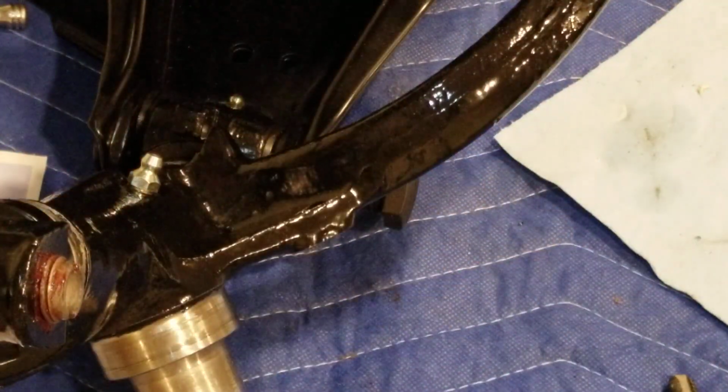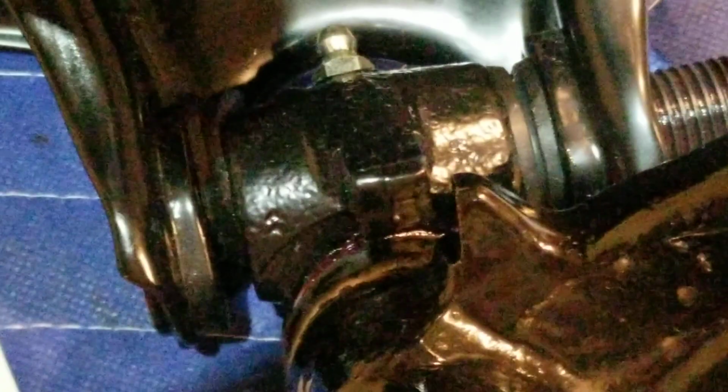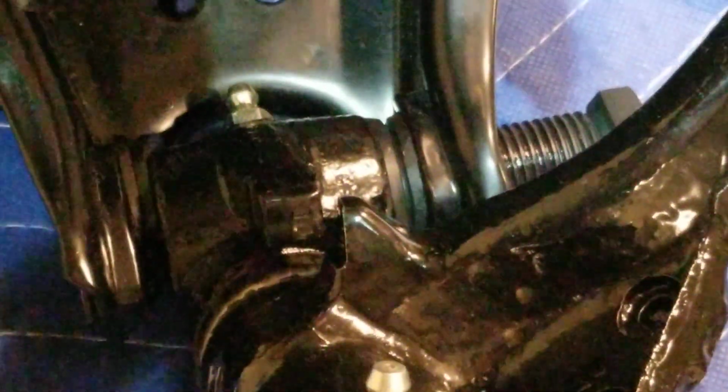So you know what, that's what I will do. I will give you a close-up. As you can see here, that second seal is a little bit out of place, and it's not really sitting where it's supposed to, and because it's squished right now, it's really hard to move it out of this groove. So I will take the bolt out here and try to position both seals. I may put some kind of a shaft in there so they both sit center, and then thread the bolt in. So I'm just gonna pause for a second, get the bolt out, and we'll roll again after.